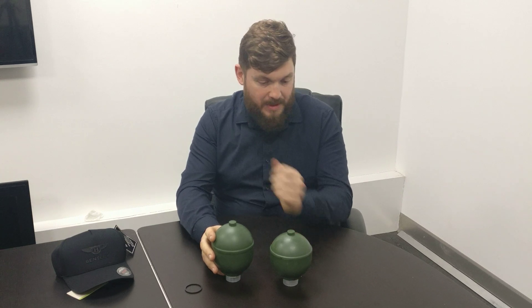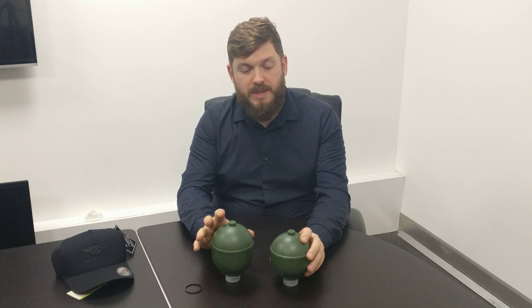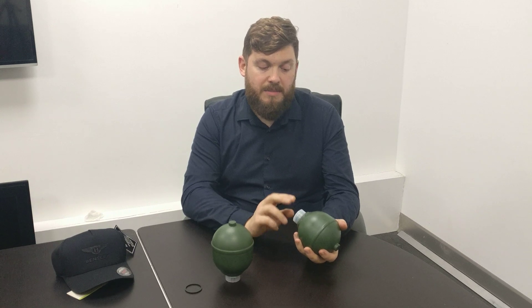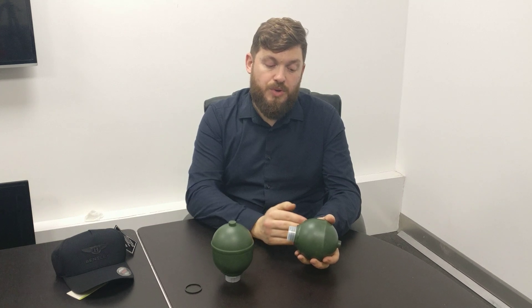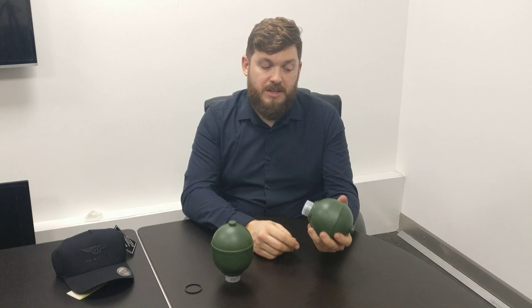Also the Corniche and the Bentley Continental went over — I think slightly earlier — to the same principle with the hydraulic sphere. This is the CD6000 GMF. This is the one for the brakes. It does the same job as the sphere on the Silver Shadow: there's a diaphragm inside, high pressure gas on one side, and that stores pressure when you start pumping fluid into it. So it's like the battery of pressure — the reserve of pressure for the hydraulic system. There are two of these, two systems, so you've got two brake pumps, two valve bodies, two spheres.